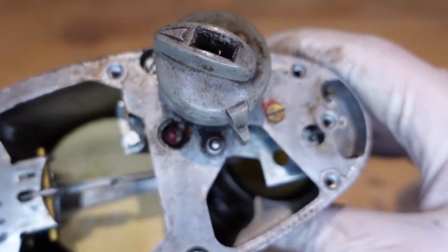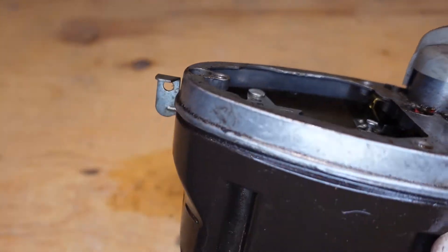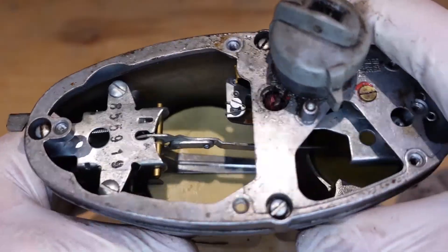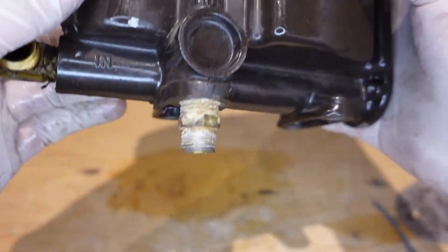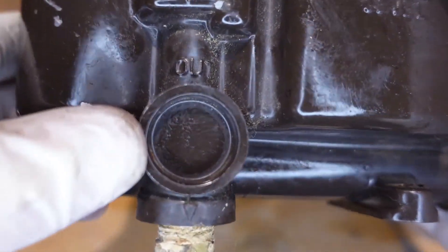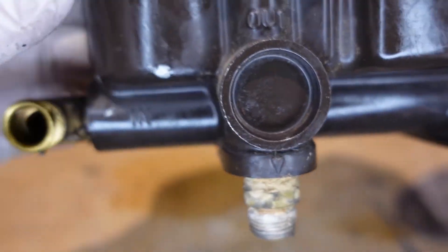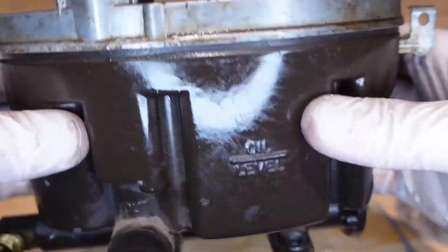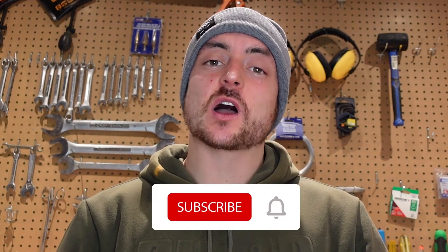So essentially that's how your stove works. The overflow in the back is just an emergency, and the on/off lever is to start and stop your stove — that's about it. It's very simple once it's clean; it should run like a charm. These things are pretty efficient. It's even labelled 'out' right here — very simple design. If you keep these clean they work wonders. I hope I didn't confuse anybody, but if you want to see an animated version I created a side-view 2D model showing how everything works — check out my other video. If you liked this, comment, like, subscribe, and hit that bell for more videos. Hope everyone enjoys their evening and see you next time.